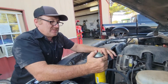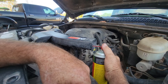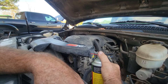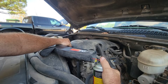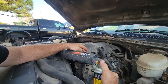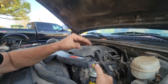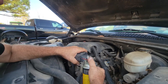Start the vehicle up and let it idle. If it still idles, gently throttle it just enough so the engine doesn't stall out. Give it enough cleaner and it sucks it in and cleans the throttle body passages. There are little passages that allow a small amount of air in when idling — that's a different area than when you hit the accelerator and a big flap opens up letting lots of air through.